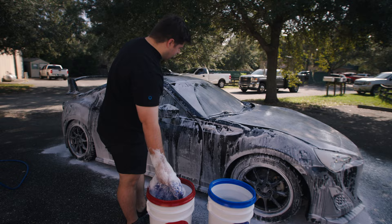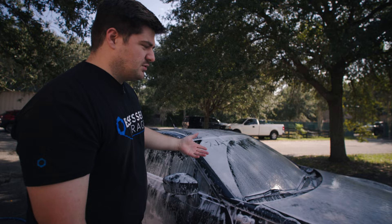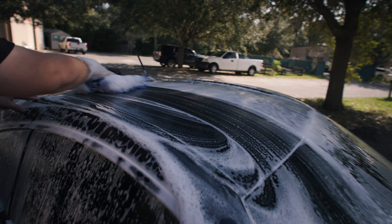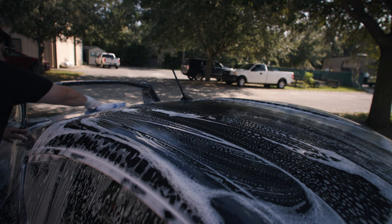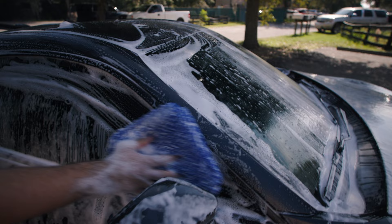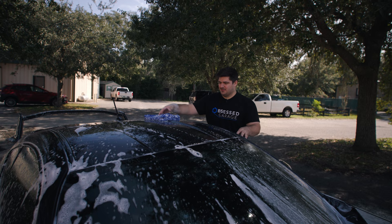From here it's pretty simple — all we have to do is wash the car starting from top down, going panel by panel. Start with the least dirty sections and work your way down to the most dirty. I'll get some soap on the pad and start with the roof, moving in straight directions — north, south, east to west — no circles because that's how we induce swirls. I'll do the roof and back glass, flip to the fresh side for the A-pillar and glass. I'm not pushing into the pad or scrubbing; I'm basically just holding it on the surface.